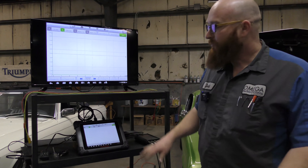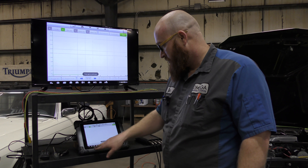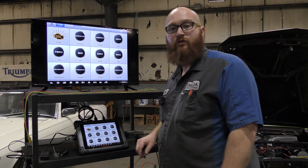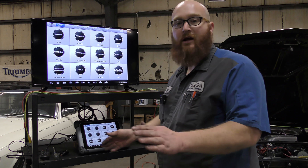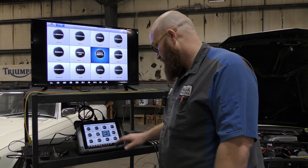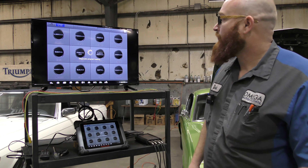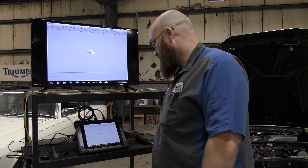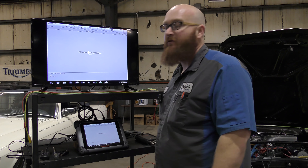Okay, we've got that hooked up. Now we're finished with the oscilloscope — I showed you guys all the different things you can do with it, the basics of it. Now we're going to move on to actual diagnosis using an OBD-II port. We're working on a Land Rover. I can still use it as a scan tool right here, wirelessly. It picked up her VIN and will be able to decipher what vehicle it is based off of that — it's a Discovery Sport 2015 Turbo 2.0.